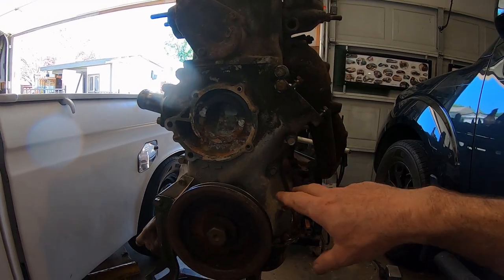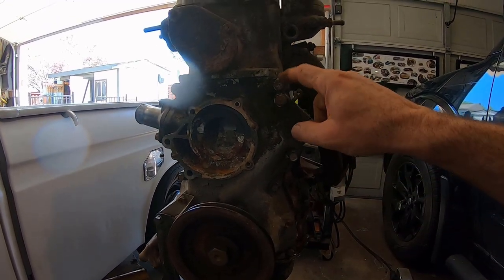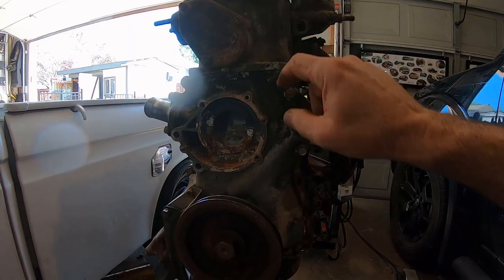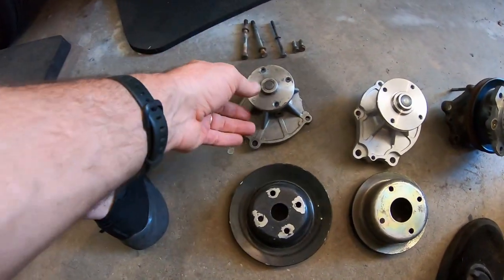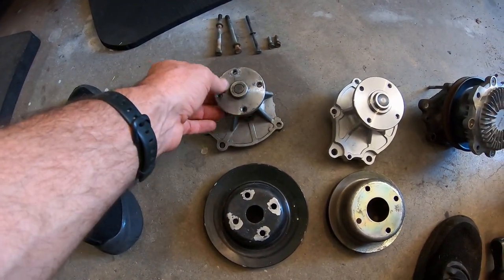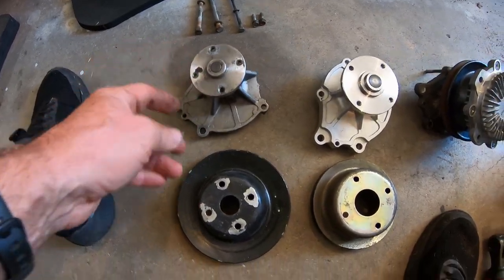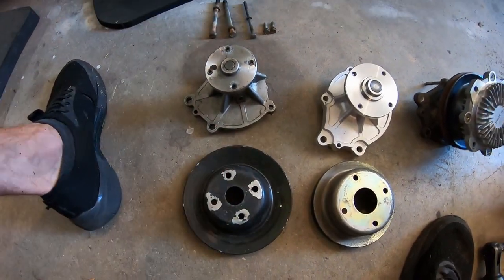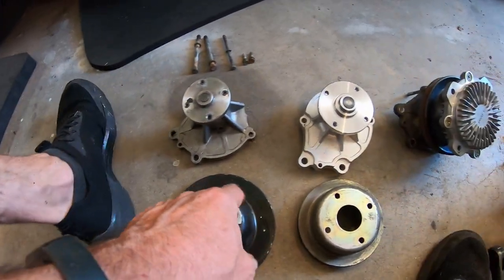Okay, all these L series covers are exactly the same for all 9 L series except for the L20B, which has this extra bolt hole, 19 millimeters taller. Water pump's exactly the same. For the water pumps, for a truck, 521, 620, 720, it's got this truck one, it's kind of long, and it's got this pulley, and it rides on the outer belt. Okay, that's the truck one.